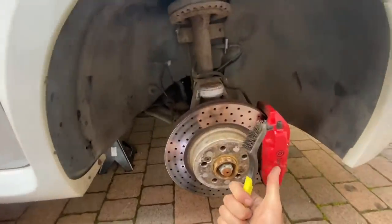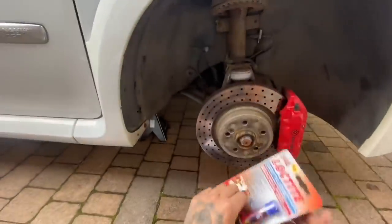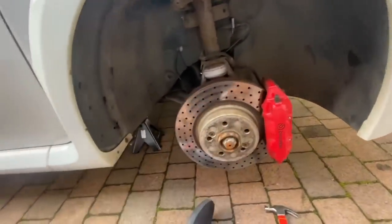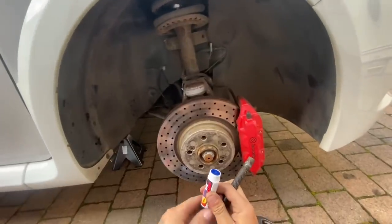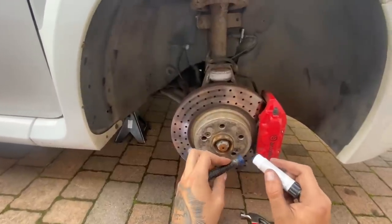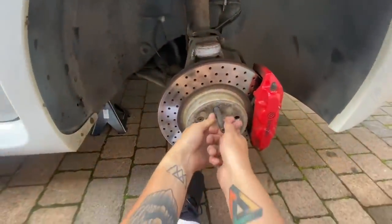We've got a wire brush but it's more of a toothbrush that George has given me, so I'm just going to clean up as much as I possibly can. It's not going to do a lot. Then grab the loctite — on the end of the studs they've got an allen key bit, so I'll put them in as far as I can with the loctite, then pick up the hex bit from the toolbox and tighten them up. Don't go crazy — you want them tight but not insane, because the loctite will do the job of locking it in nice and tight. Put quite a fair bit of loctite on — when you've got wheel bolts holding the wheels of the car you really don't want these coming off.